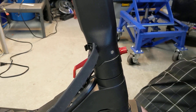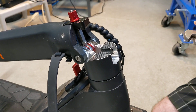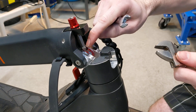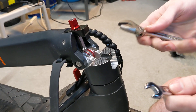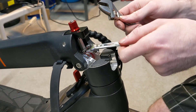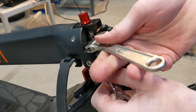If you're still getting steering shake and it's all the way tight, what you want to do is go inside here with an 8mm wrench and a 9mm crescent wrench or adjustable wrench — you need two of them. You need to move this nut further down, then this needs to be screwed further. Make sure they're loose, give it a couple turns so the nut is now further down, then hold it in place while the top piece gets moved down.